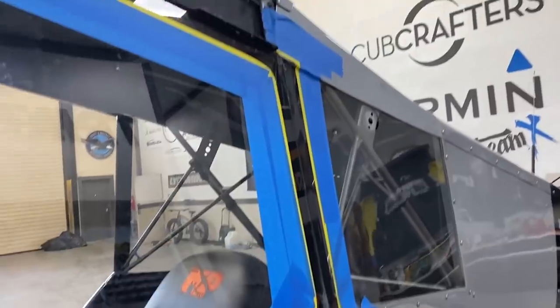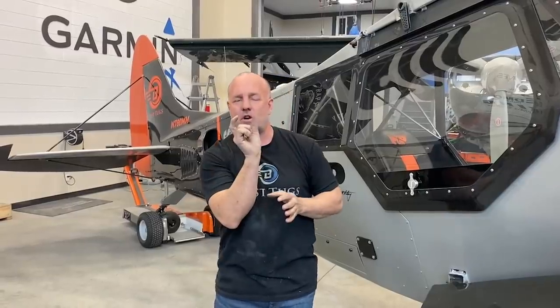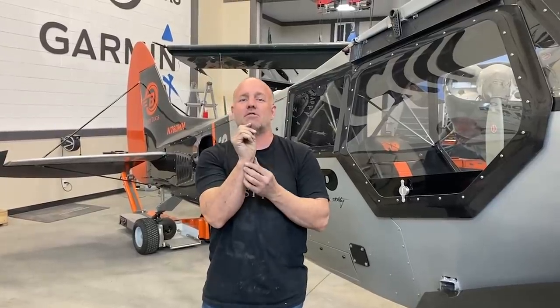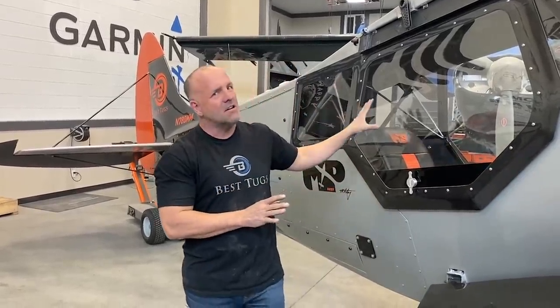And the way I did that is I've got the frame, the interior carbon fiber piece I made, and I've got the exterior piece I made, and rather than the screw going through the window frame itself or pinching the frame tight, which would make it hard to get out, I actually designed it where the screw goes in, it pinches two carbons tight together, and there's just the slightest gap between the window and the door frame, and then that's got a piece of sealant tape around it. Why I did that is I wanted an airtight seal, but I didn't want it so tight that it couldn't slide out. So it's a designed knockout.